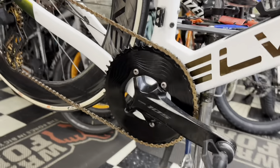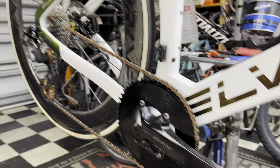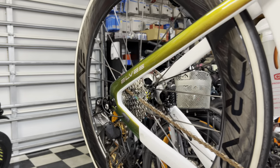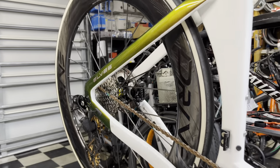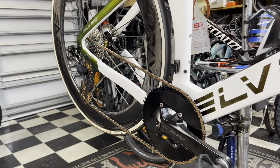With a one-by chainring I can get a confident configuration of gearing. I have on here a 52-tooth chainring up front paired with a Shimano 12-speed cassette in the rear — this is an 11-34 in the back. So I have a ton of gearing, a lot of which I don't need. A bunch of these gears back here are redundant. There are a ton of configurations of what I have used.